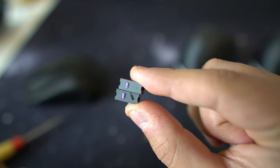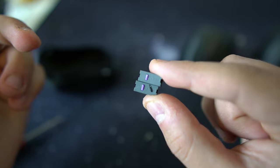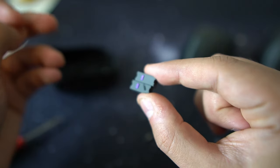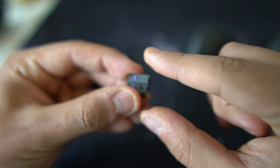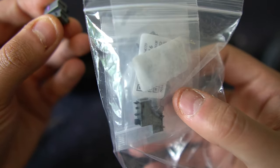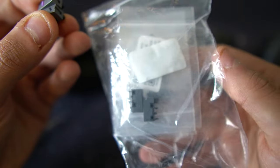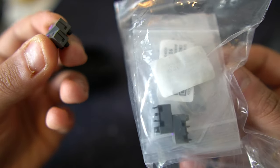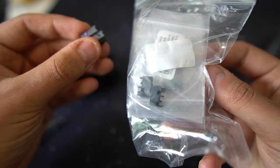I used these really extensively with the original implementation, where there was a screw in here, and by repeatedly clicking and using the mouse, the plastic just wore off, and now you can't even properly use them anymore, and that really, really sucks. So what I did was order V2 switches from AliExpress. You can get 5 pairs of V2 switches for around 28 euros plus shipping, which I think was free. I'm not really sure, but it's not a lot. I just had to wait for a month till they were here. And now I'm using V2 switches instead of V3 switches.